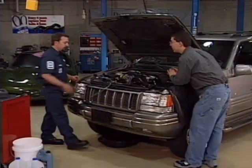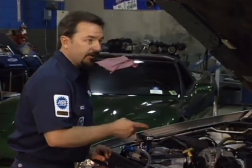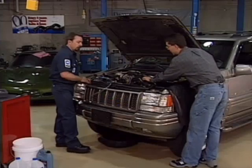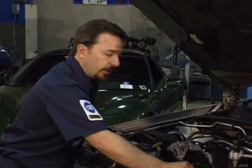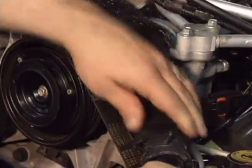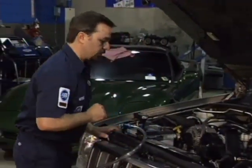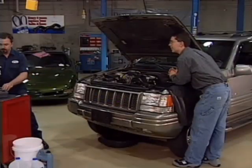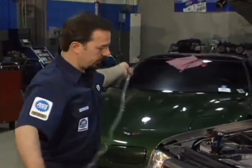What you'll notice here also is that this is another pressure test — we're checking the system for leaks right now as well. We can see on the scale that this isn't moving at all, so we know the system is not leaking anywhere. Should we be concerned about the hoses being collapsed? This isn't going to damage the hoses, but if you're dealing with a hose that's very old, you might hear it cracking or it might get very deformed right up against the edge of the connection — that tells you there's a weak point. But it'll expand right back to normal. The vacuum test is very effective for finding even very small leaks on heater cores and head gaskets as well.